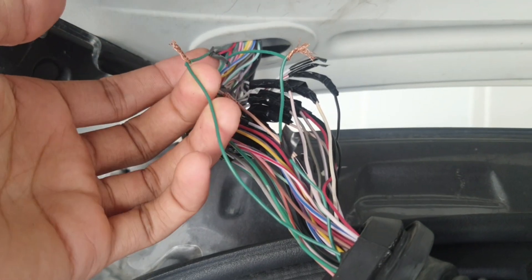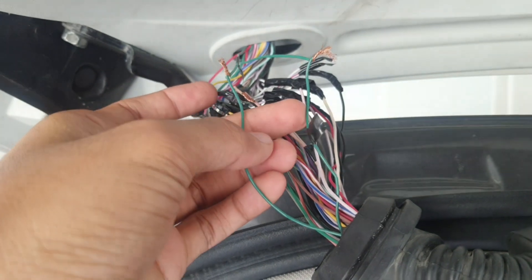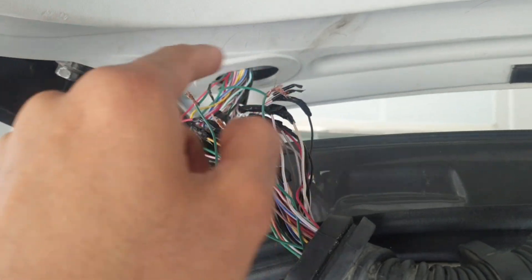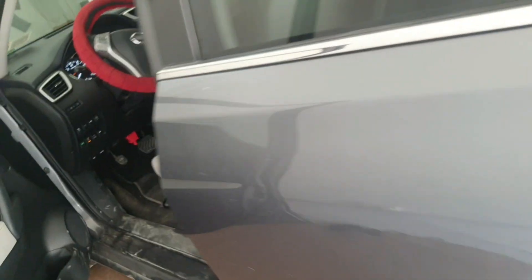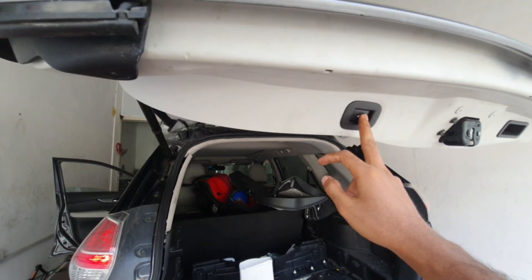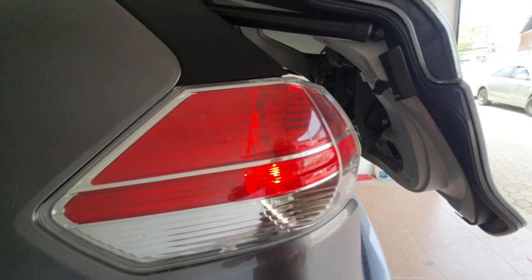And then I find out that in this green wire for the trunk motor they fixed the wrong component. That's why the fault appeared. Now I fix it the right way. See — this trunk before was not working, and now it's working perfectly. Great success!